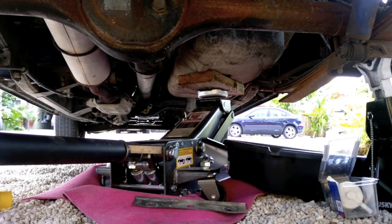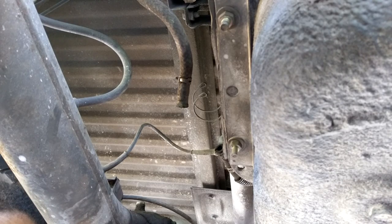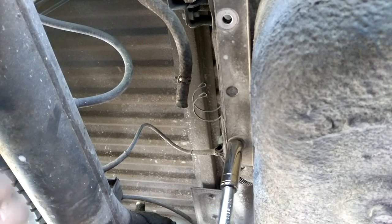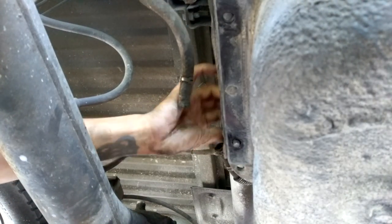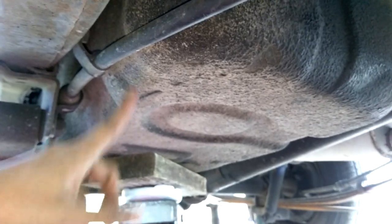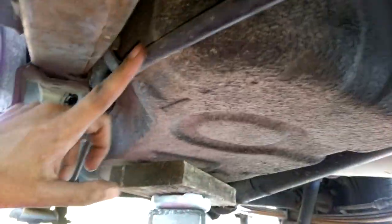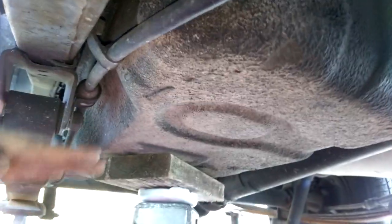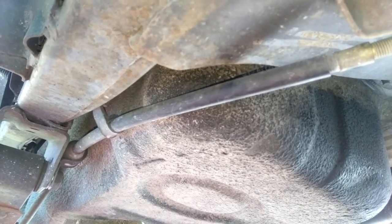We have the jack in position. Now we have our jack hooked up to the bottom of the tank, holding it in place once I remove all the pieces. Your tank should be supported by the jack, so once you take these off it should not plummet onto your head. This is part of the parking brake, which I'm now removing so I can take off the tank — it's blocking it here all along the length. I'm trying to unhook the parking brake so the tank can come down a little more so I can reach the top and unhook where the fuel pump is.